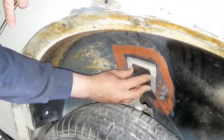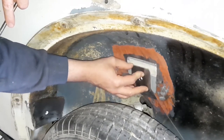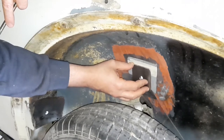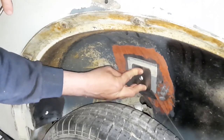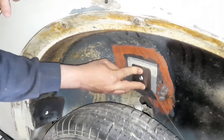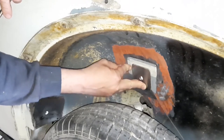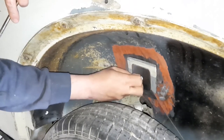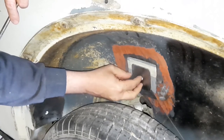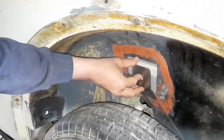So if you had the additional plating just behind here the same size, there would be more strength in that area, so there's a likelihood that it wouldn't deform and it would just pull through the metal. So by having the larger spreader plate behind it, it just means everything can spread the load more evenly, and it should stop anything from tearing through.